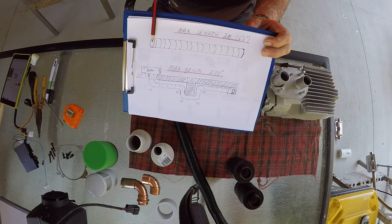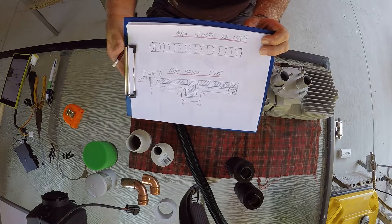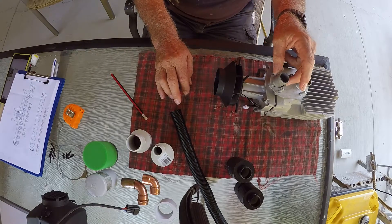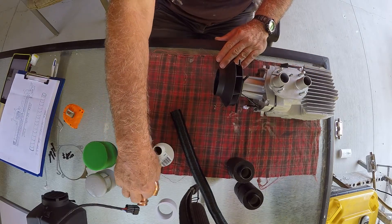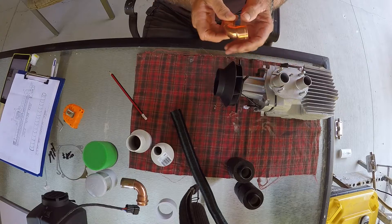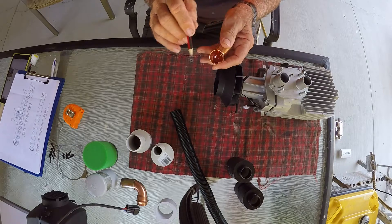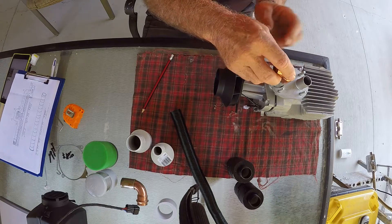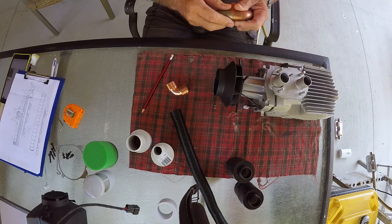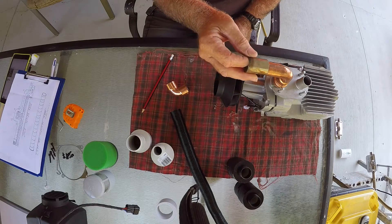My opinion is that if you go longer than about 500 millimeters, you really should go bigger in hose size. You can't put a bigger hose directly on the heater because there's heat there, but with a bit of thought and planning you can use a copper U-bend. Put cuts in it with a hacksaw, apply some silicon gasket sealant, and put a hose clamp on there to clamp it up tight. This way you can upgrade the actual intake hose to a larger size.